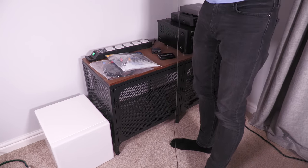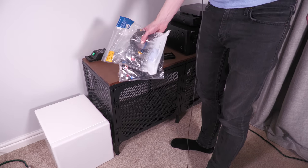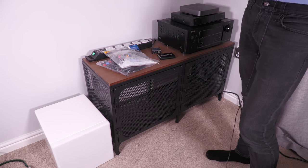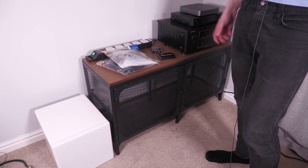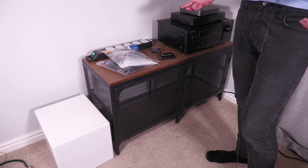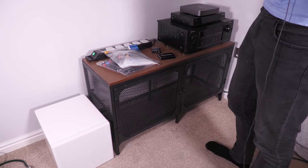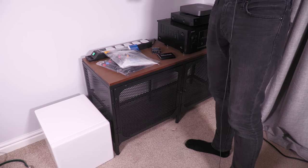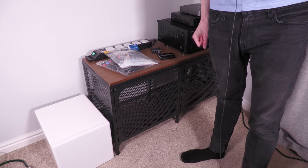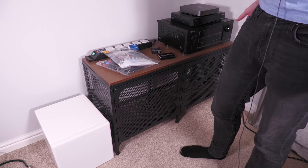And then down here, I've done what I've needed to do for a very long time, and I've got some brand new HDMI cables. Because what I've done in here is basically use HDMI cables that I've had lying around, which I've probably got with a monitor or bought in a supermarket or whatever. Just over the years when I've needed an HDMI cable, I've bought a cheap one. And that's fine, but now I'm trying to do 4K 60 with HDR. I'm having all sorts of little dropouts. Certain cables don't work. Certain cables work between certain devices, but not other devices. I can see a cable down there that I know for a fact I bought in about 2010, 2011, so that's over 10 years old. And it's just becoming a bit of a nightmare.